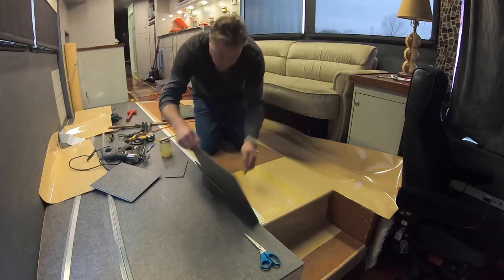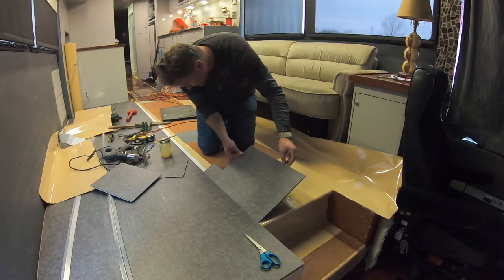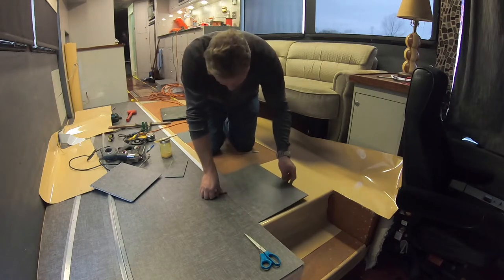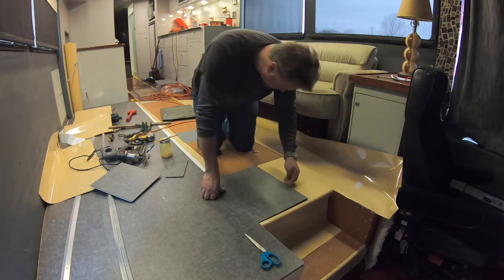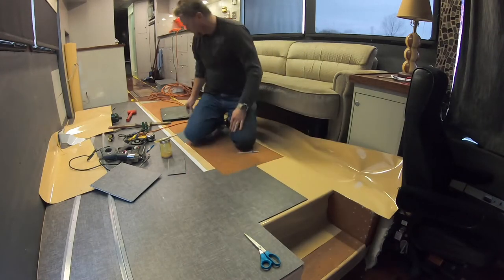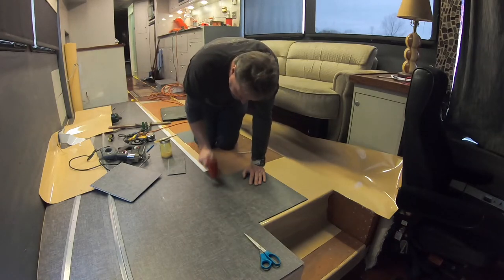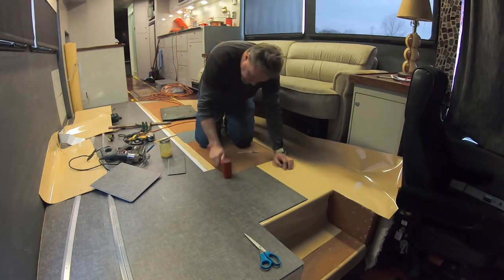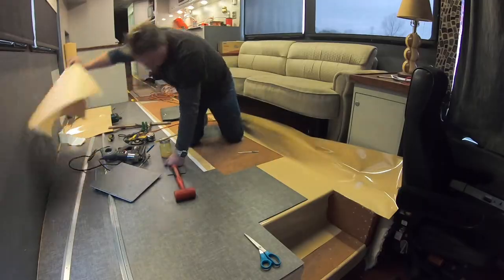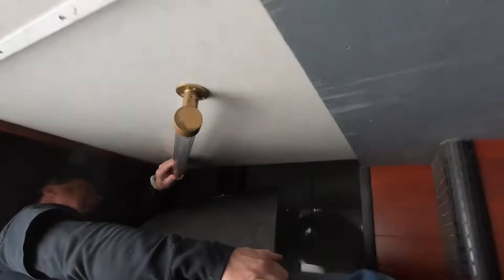This gray tile went pretty smooth. I lost a lot of footage due to technical issues. I laid out this vapor barrier slash padding throughout the bus where the gray flooring is. And once I snapped it in place, I went back over it with a dead blow hammer and just knocked along the seam, and it seemed to interlock and the gaps went away. It really worked out nicely. Along all the edges of the hatches, everything was glued down, including the vapor barrier, rather than just stapled.